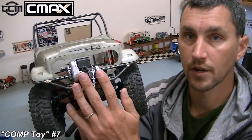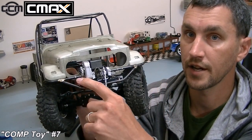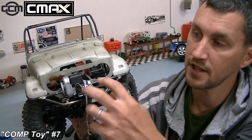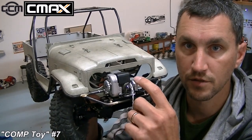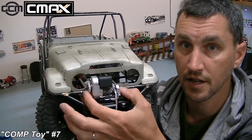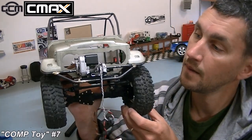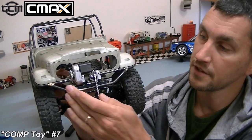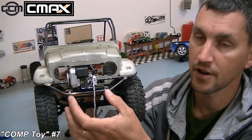The winch is in. What I did is I took these two crosser tubes — you remember how these used to come together here and I just had the two tubes from the one perimeter bar meeting here in the middle. So I simply just notched that out so that the winch would sit right in between the tubes — nice and snug in there, not tight but snug. There's no spare gap, so that looks kind of cool. This will protect the front end; I'll get my bumper points for that. It's all frame-mounted, that's important.